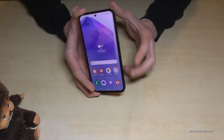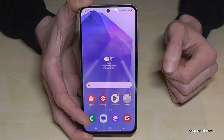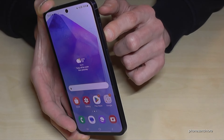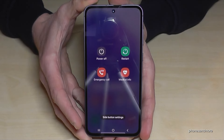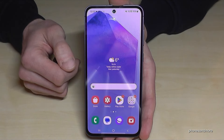I think you have realized it already — if you long press the power button, you wake up Bixby. But how to power off the phone? For that you will need, next to the power button, also the volume down button. Long press both buttons together and then you are finally at the power off menu. Just tap on power off, then confirm power off and the phone will shut down.